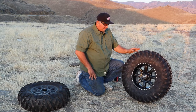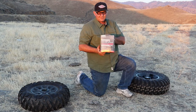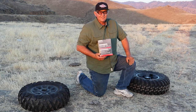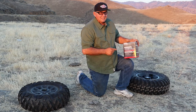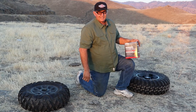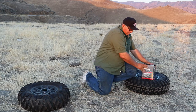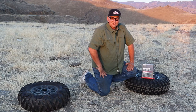One thing we've run across recently is we purchased some oil kits like this from the dealer. They're sealed up, so nobody at the dealer has done anything with them, but we open it up and start to do our oil change, and it has the wrong oil filter in it. So we recommend that when buying one of these kits from the dealership, double-check the oil filter and make sure you get the right filter.